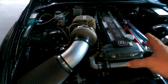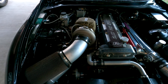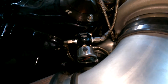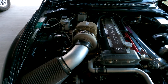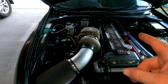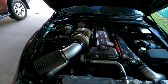Okay, so I went back and went for a spirited drive — still smoking. So I took that 1.5mm restrictor out and put the 1mm in, went for another drive, and guess what? I saw the tiniest puff of smoke on decel. So that's telling me that OPR T40 is doing sweet FA. I'll have to get onto TurboSmart or they can get back to me. Sort of fixed the issue with a 1mm restrictor on the OPR — but yeah, why do I even have the OPR?